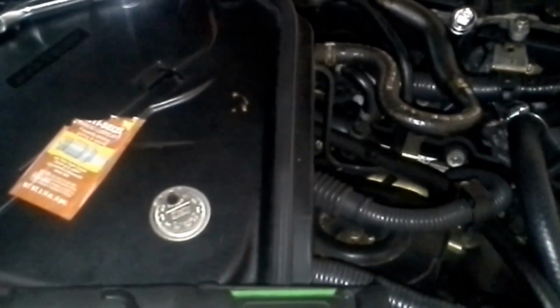Okay, I figured I should mention the spark plugs also, even though I'm doing the coil packs. The spark plugs will not come pre-gapped, so you're going to want to use this little tool here to gap your plugs right around. The spec on it is 0.043. Also, you want to make sure you put some anti-seize on the plugs, because it is an aluminum block, and these plugs are also aluminum, so they can seize.